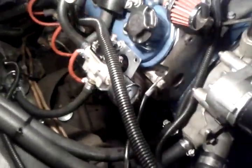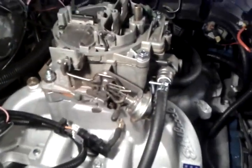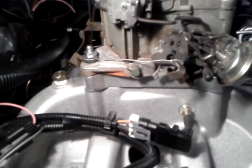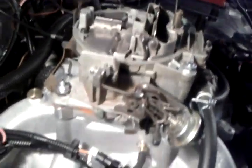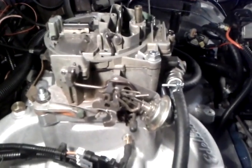Show it off a little bit. Fuel pressure regulator — moved the gauge, set it at 6 psi. It's a '68 Quadrajet off a 350 Chevy Corvette. To mount it on the LS1 Edelbrock intake, I unfortunately — I don't like spacers — I used an adapter, which causes some wide-open fuel issues, in my opinion, when you're using a spread bore carb on a square bore. What are you going to do?